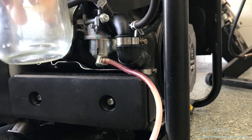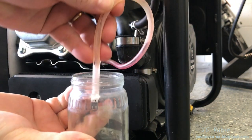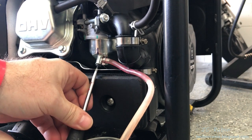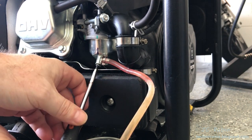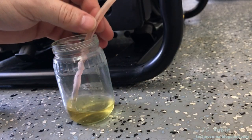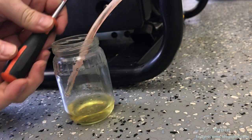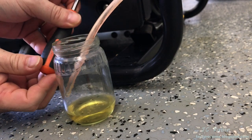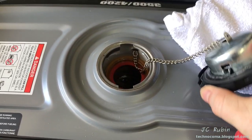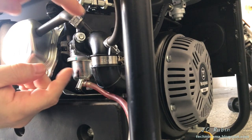This is generally found in appliances like pressure washers, lawn mowers, and generators. By draining the bowl before storage, you avoid the gas rotting and drying, forming contaminants in the emulsion tube, needles, and jets. For this I have a small clean glass jar — it won't be much gas. I'll put the tube right in the jar, give it a couple turns with a flathead screwdriver to open the hose, let the fuel flow out into the jar, then close the valve. The recovered gas is dumped right back into the fuel tank — no waste.